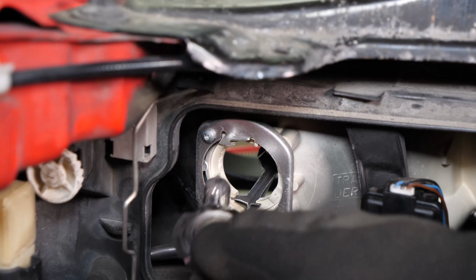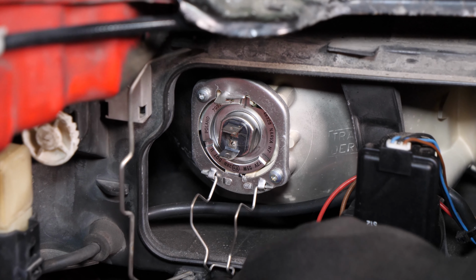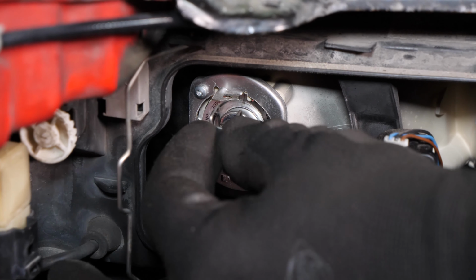When putting the bulb back in, it is important to consider its orientation. Identify the keyed connections, position the bulb in its housing, then push the hooks down and finish by locking it into the holding studs. Reconnect the electricity connector. Put the rubber cover back on.